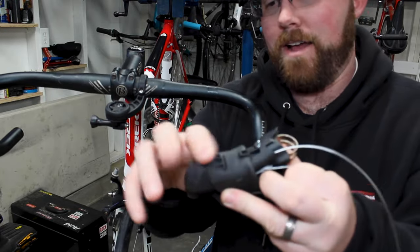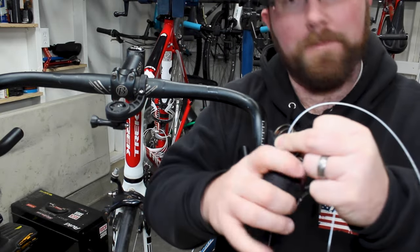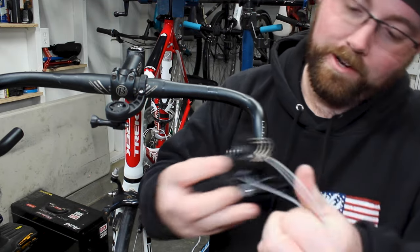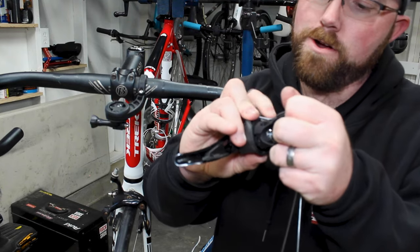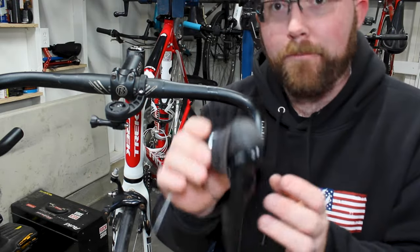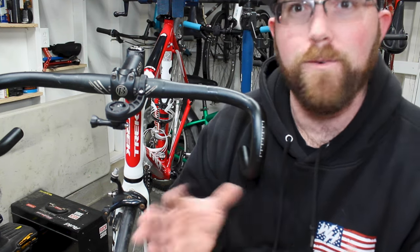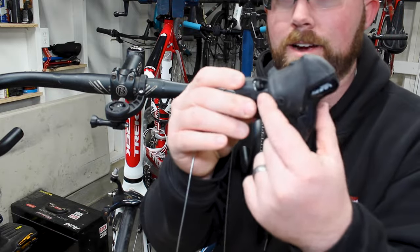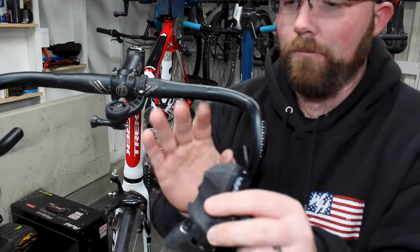From there you can test it and make sure it works, which mine does perfectly. Then put the little cover back on the shifter, and that side is set. Right before you close up that boot, I like putting our cables in first and then putting them on the bars — I think it's a little bit easier to maneuver and see everything. Once the cables are set in there, you can see the bolts for tightening our little clamp. The clamp is nice and loose right now, so we need to put this on. Make sure you put them on the right side — with these newer Shimano shifters, the label goes on the outside of the bike, so Shimano Sora faces the outside.